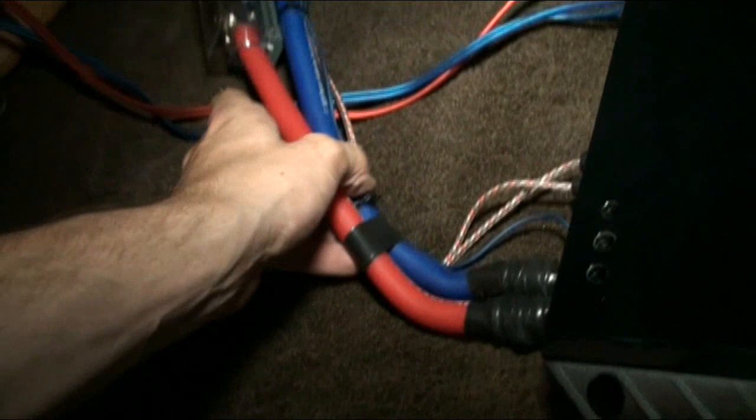But there's the box. I didn't get to hook up my lights yet, so I'm going to do that now — the purple lights on the inside. I'm going to hook them up to the headlight switch so when the headlights are on, they're on. So I can still show them off in the day if I want — all I have to do is turn my headlights on. I made that a little neater. I just zip-tied, and you know it has to crease there — that's where it folds up. And I just zip-tied the RCAs to that zero gauge and it runs down there.